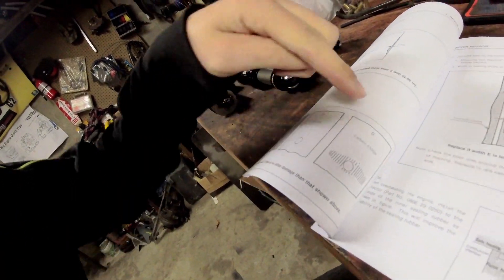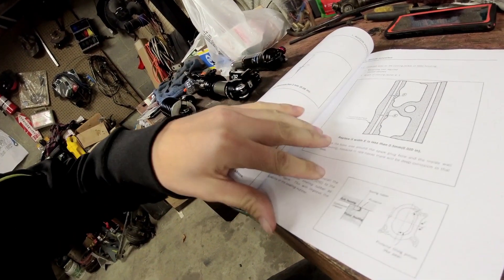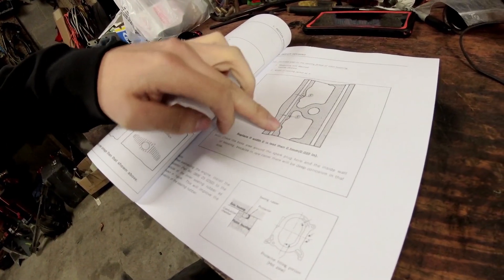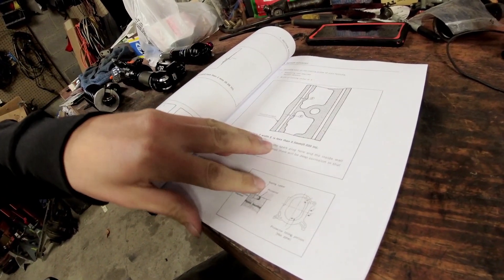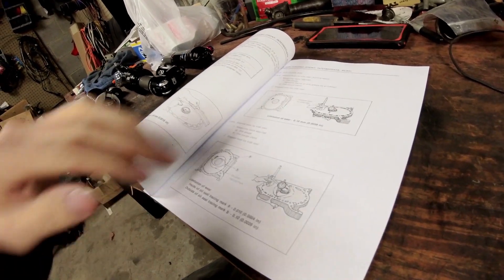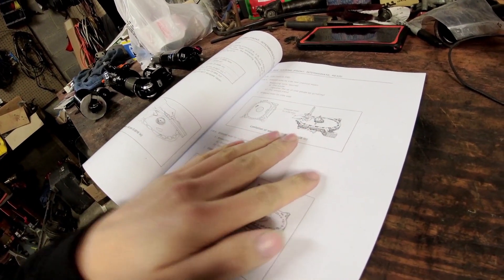The document also covers the surfaces around your spark plug holes — whether there's scarring — and your coolant passages, checking if corrosion has progressed to the point where coolant seals are prone to failure. This is specific to older motors; newer engines have the coolant seals in the iron themselves.